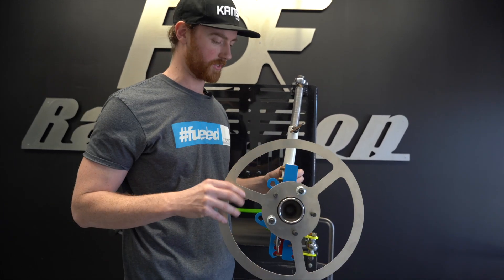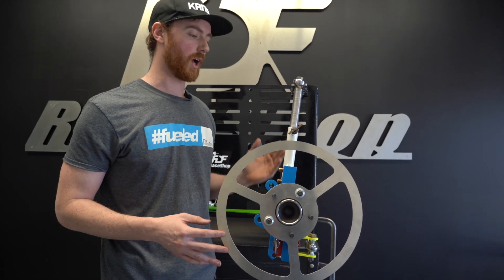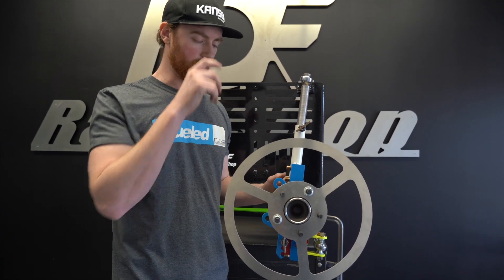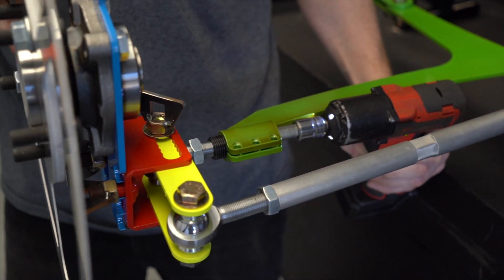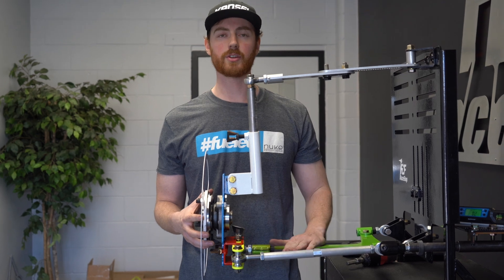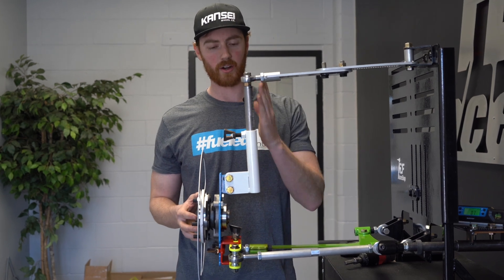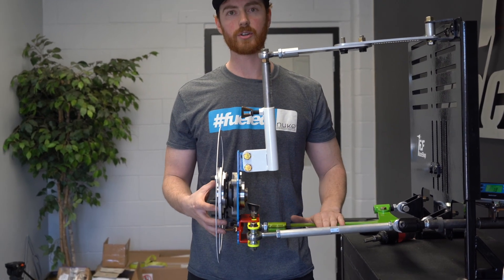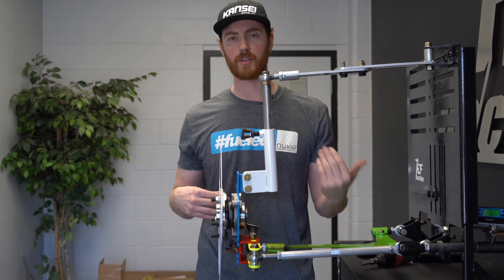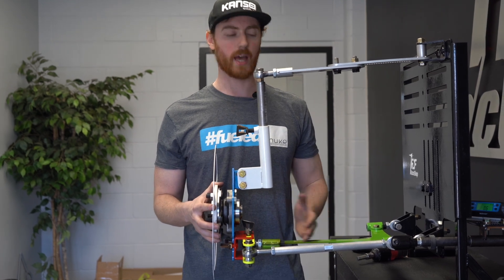What I've really noticed with this jig is you get to visually see so many things that you could not replicate on a stock car. What we're going to do is increase our camber value using the lower control arm, and then increase our camber value using only the wheel. The variable here is that our KPI is going to change when we use the lower control arm versus when we use the knuckle, and with this you'll see the difference at full lock between the two options.